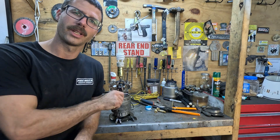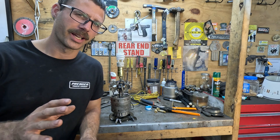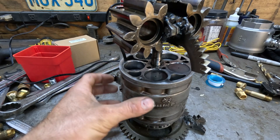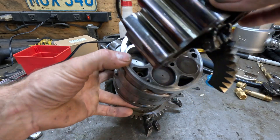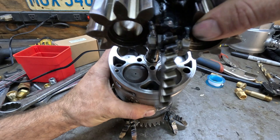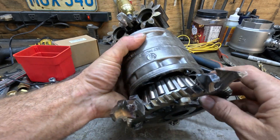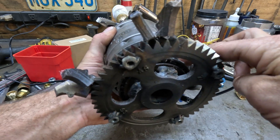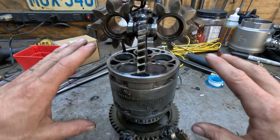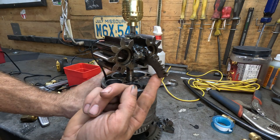If you're interested in how these modern swash-plate type AC compressors work, I built a lamp for my youngest boy and the main body is from an AC compressor. As we look in there we can see a bunch of pistons — in this case there are five bores, so there are pistons on the top and if I turn it you can see them move. There's a swash plate in the middle. There's also a piston on the underneath side — five piston tops on top, five on the bottom — and then there are some reed valve systems to help regulate the ins and outs. Pretty cool.